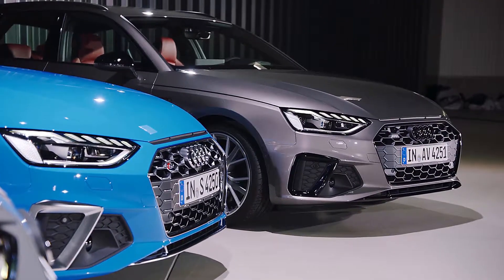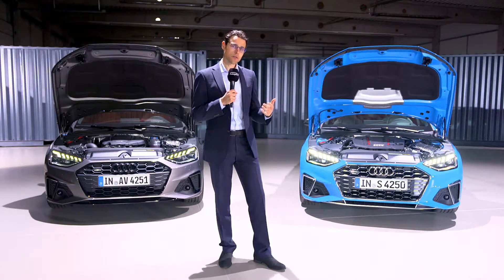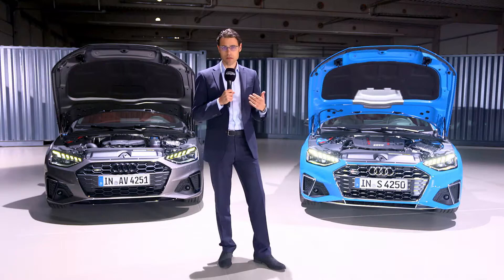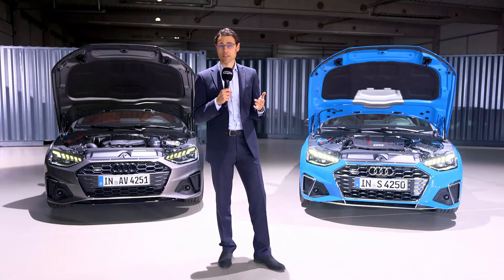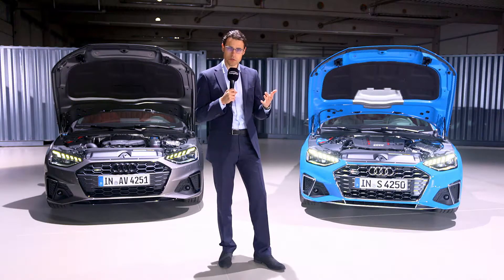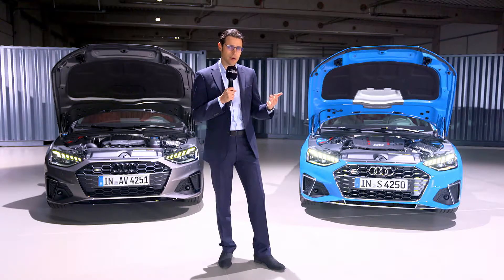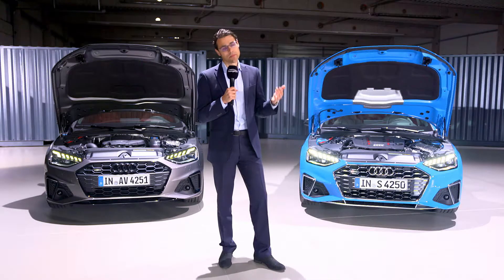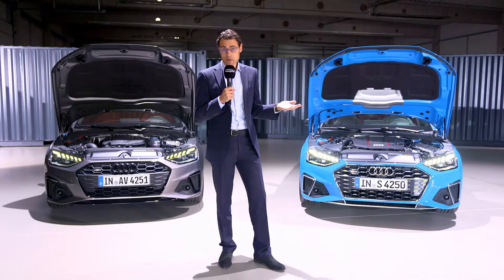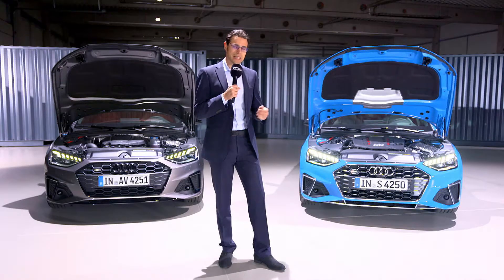There's a wide variety of engine choices: a 2.0L TFSI turbo petrol engine with different horsepower configurations, a 2.0L TDI diesel also in different horsepower trims, and then the 3.0L six-cylinder — a 3.0L TFSI or 3.0L TDI. Interestingly, the S4 for Europe and Russia will be the S4 TDI — the 3.0L diesel with around 350 horsepower. In the US, you will still get the S4 as the petrol engine with 3.0L TFSI, also around 350 horsepower. They're quite equal in acceleration — 4.7 or 4.8 seconds to 100 km/h. The diesel has 200 Newton meters more torque, and the petrol is a little bit faster, but I know some will criticize that you only get the TDI in Europe.